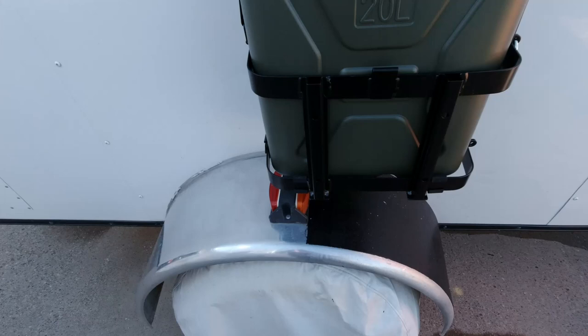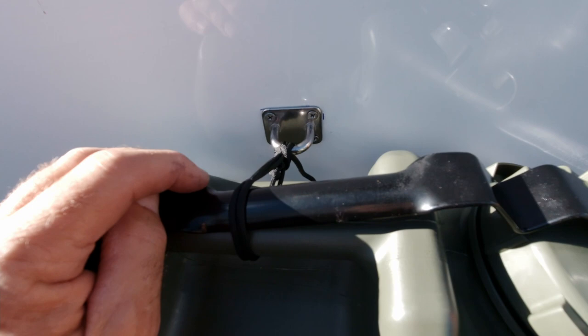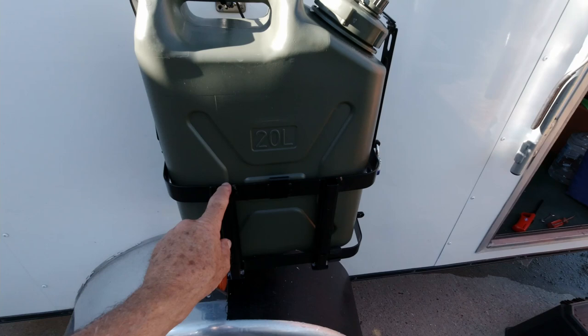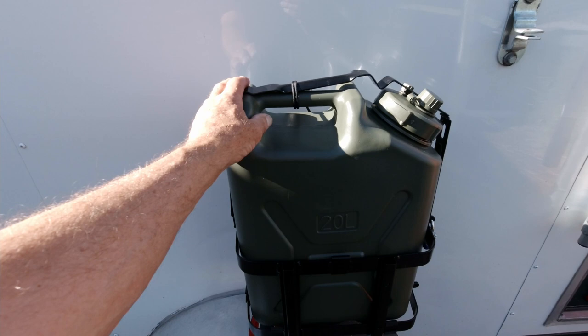This is how it ended up. I did put that pad eye on top — you can see it right there. I just got it secured with paracord, and that keeps it from rocking as we go down a rough road. I've heard of these welds breaking in different places on these mounts, so I figure I'll just try to eliminate that possibility. I think I'm satisfied with it — I think it turned out all right. That's how you mount something on a hollow-wall trailer, whether it be a spare tire, water tanks, fuel tanks, or a battery on the side.